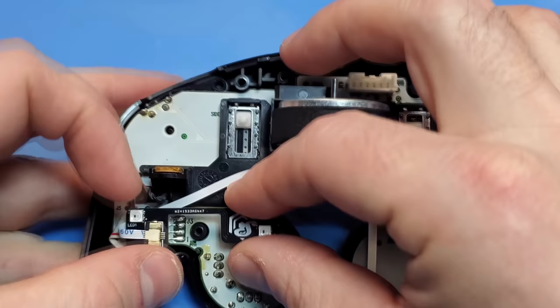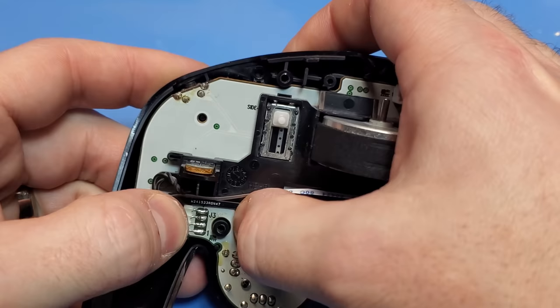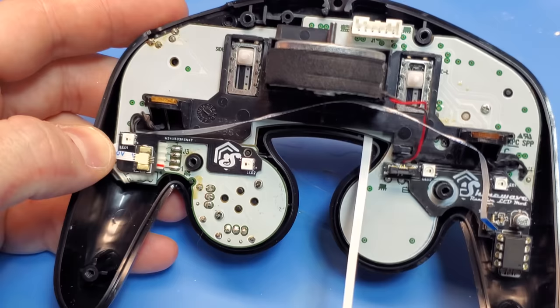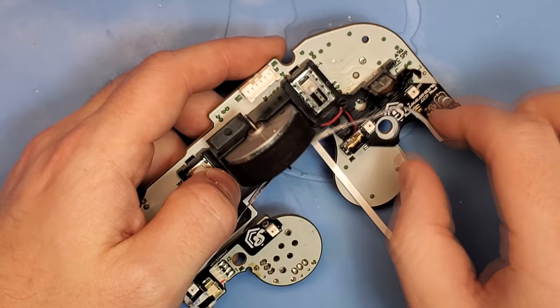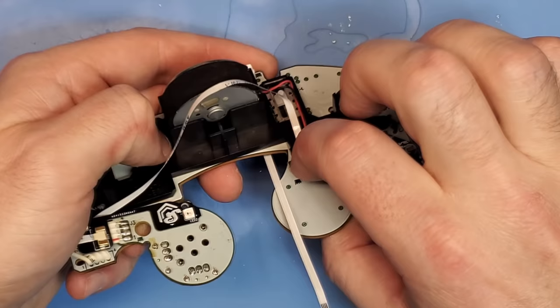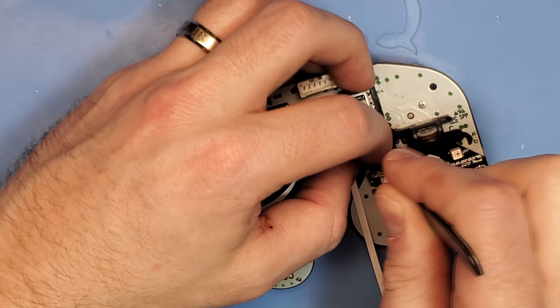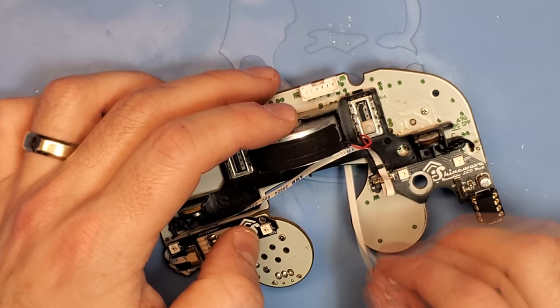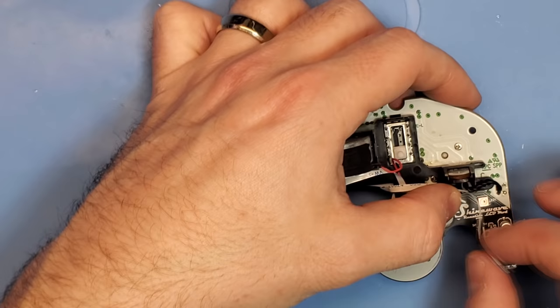As I continue to do the install, I'm pretty much just at the point where I'm sticking down the PCBs and routing cables and making sure that my cable management looks really good. With the two flex cables, it just takes a little bit more time to get it to look really nice, but honestly it's pretty easy to do. I'll add just the tiniest dab of hot glue to hold those flex cables in place. One thing that was pretty fortunate was that in the design of the original GameCube controller, they added some spaces for cable management specifically with the rumble motor — so we're going to take advantage of that and route one of our flex cables through there for our C-stick board. Overall, I'd say the install is pretty easy and you're looking at maybe about 10 minutes or so for the first time. If you start getting good at it, you might be able to do it even faster than that.